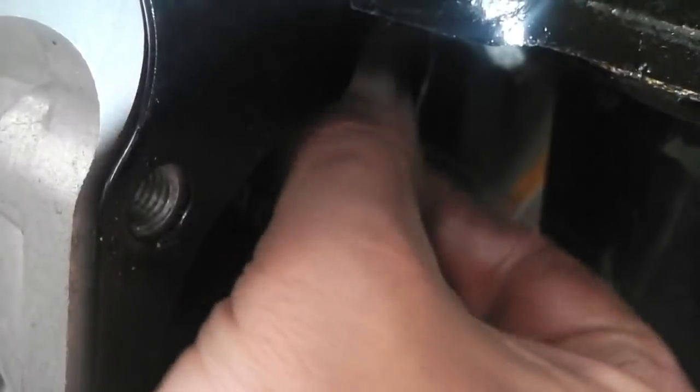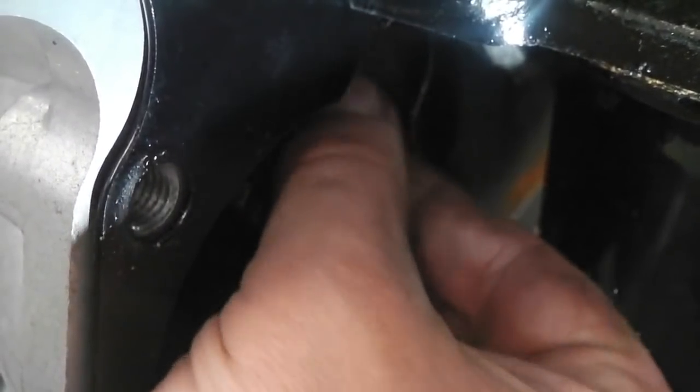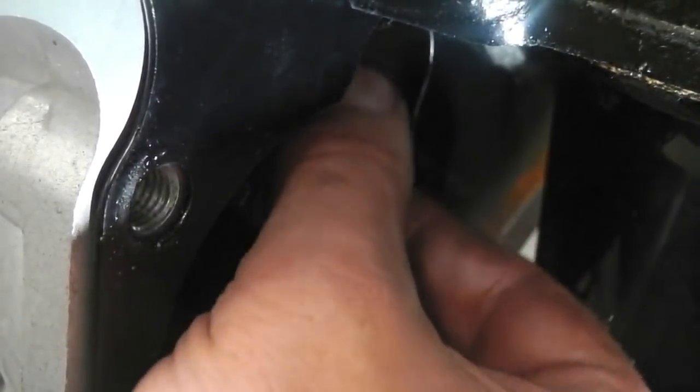The real deal has a washer built in. So out we go with these. And that's basically all we're doing. Then we can put the starter motor in. Nothing to stop us just quickly pulsing the starter motor on the jig and seeing if it engages all right and throws the engine round.